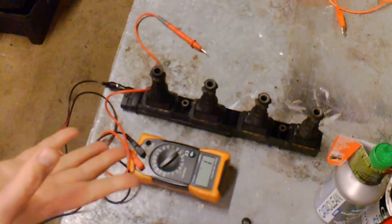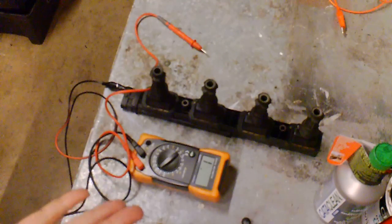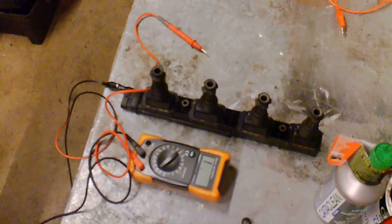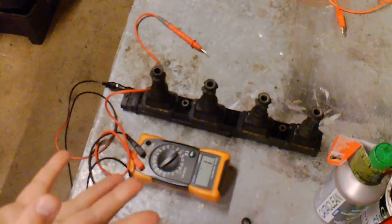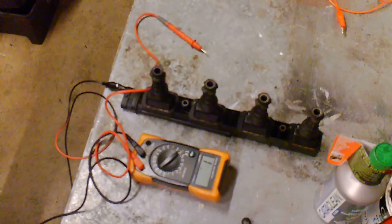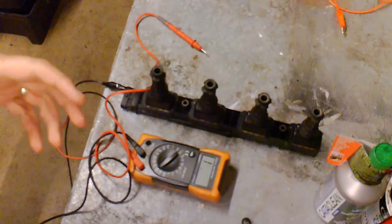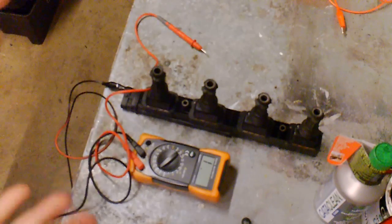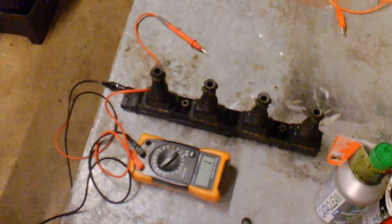But obviously with some of these you get spark quite often, but it's still a problem with the cassette itself. So one of the things I look for is continuity and resistance readings. When you go down to the scrap heap, you can compare your old module with the module you're going to pick up and see if the readings are the same or anything drastic. Get yourself a pen and paper as well to write some of this down.